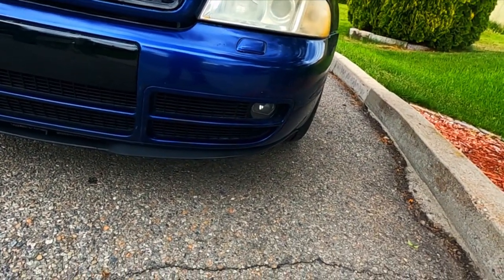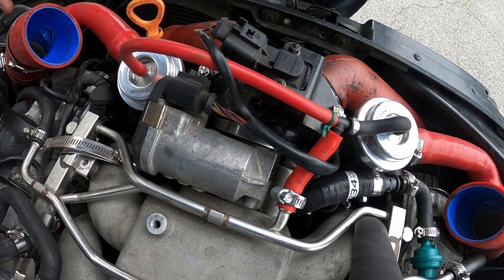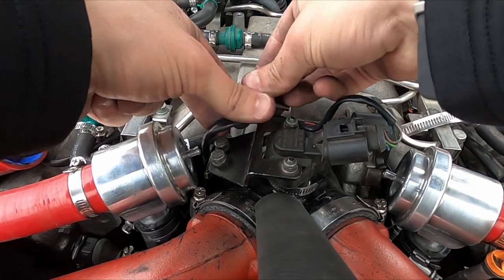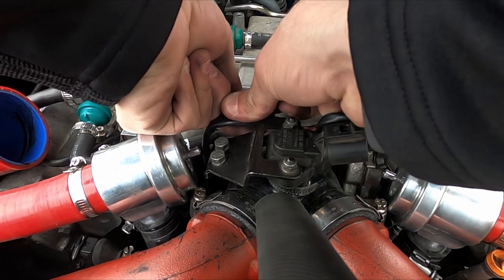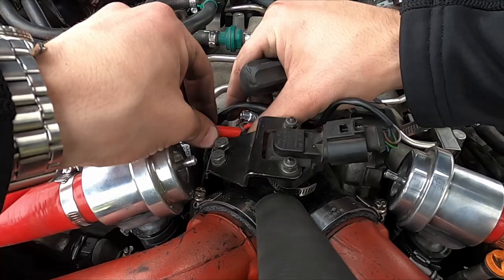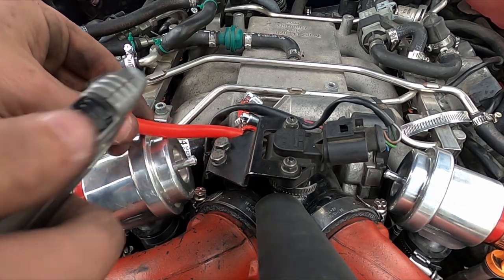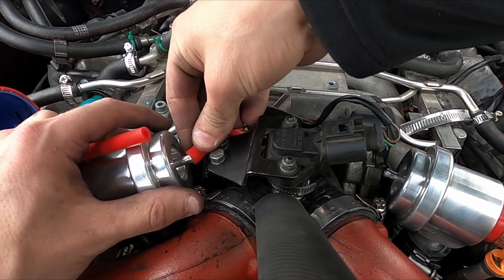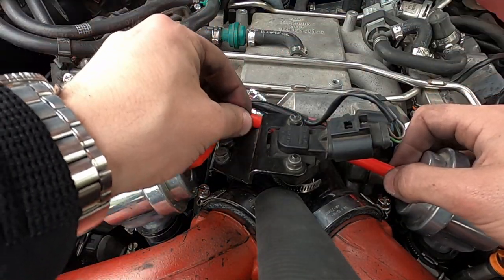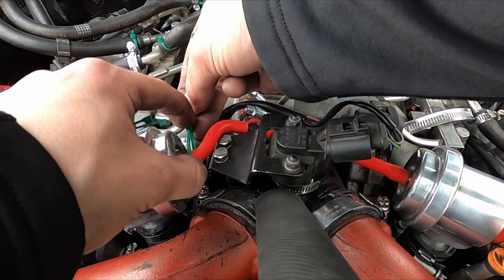I want to correct something in the engine bay that a helpful commenter pointed out in the last episode. These diverter valves are not in their OEM position — they're actually rotated 90 degrees. I unbolted them and replaced them back into their factory position, and took the time to rebuild with reinforced silicone the little actuation system above them, so the hoses won't collapse when the diverter valves are being actuated. I absolutely love when I get helpful suggestions from my subscribers — I've also seen my community help troubleshoot each other's problems in the comment section. I cut silicone hose to make sure it was the right length and pretty much mimicked the original pattern.